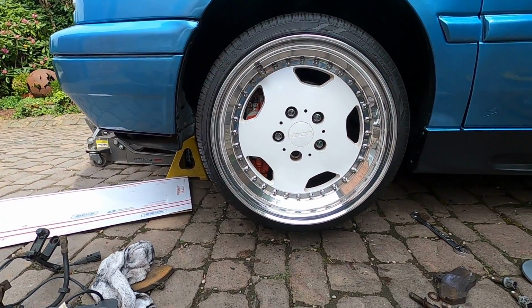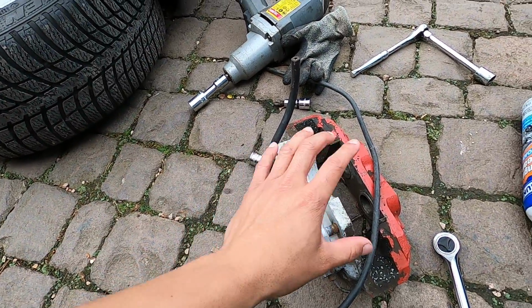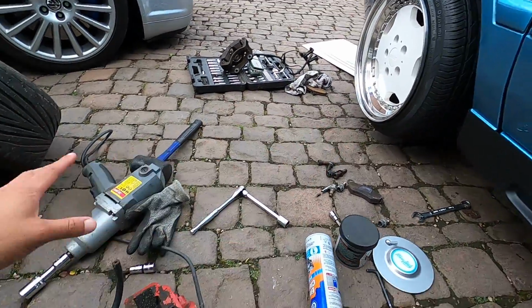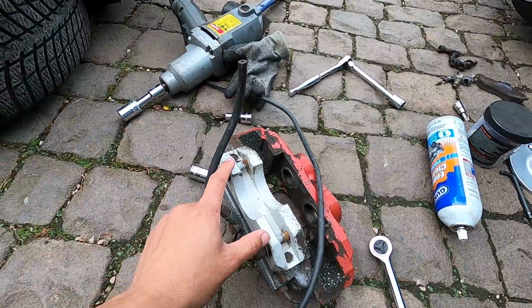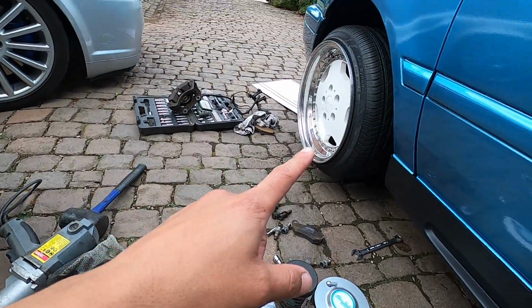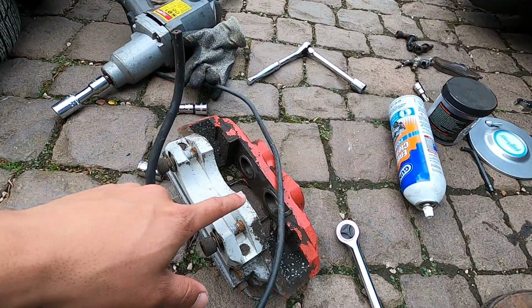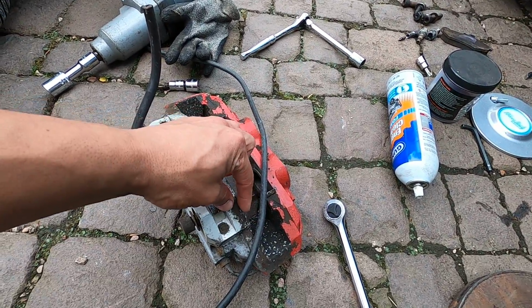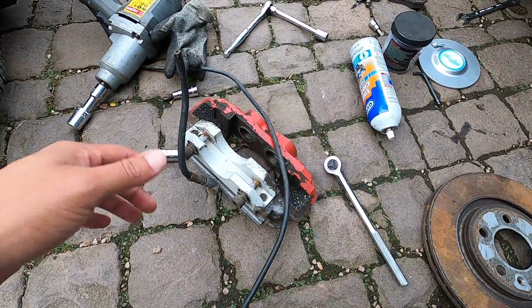And look how good those brakes look back there. That's so cool. So the plan now, I'm gonna do some research and see if this company or any company makes a bracket for these calipers to fit right to a Mark III. If not, we can go ahead and modify this one if I can find someone to do that. Just have the holes centered properly to actually match the hub of my car, and then obviously we want the caliper centered and not hitting the wheel, and then some of this trimmed off so we don't touch the lower control arm. But with that and then the right size rotor, I don't see why this setup actually wouldn't work.